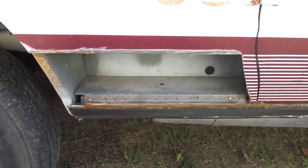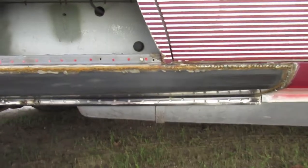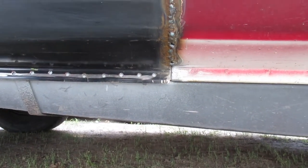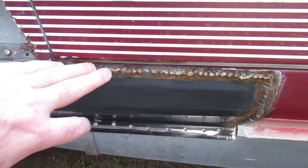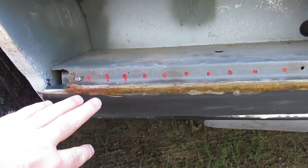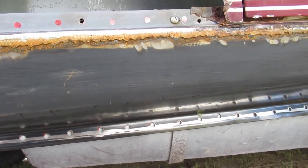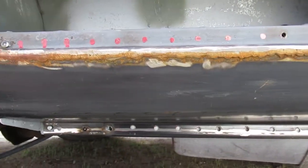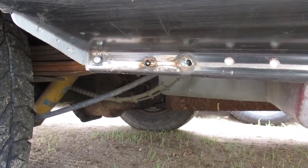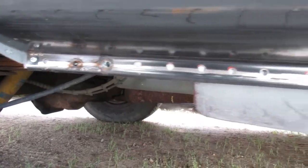Time for an update on the repair. I got the rocker panel in — I think it worked out pretty good. I found that welding upside down puts a lot of heat into the panel and it starts to burn through, so you have to take your time. I didn't do all the grinding yet — it was getting dark. I did some grinding across here and it's looking pretty respectable. Some body filler over top would be the best option. I also found the pinch weld wasn't close enough together to get the spot to take, so I stopped and I'll do that today.